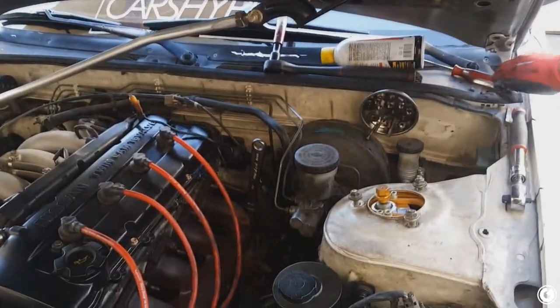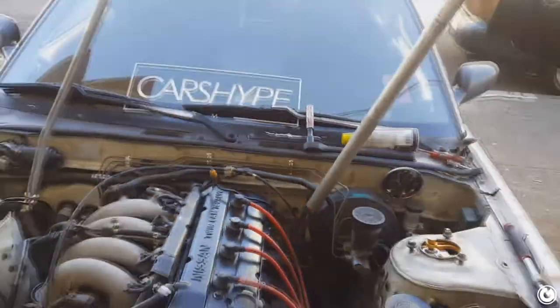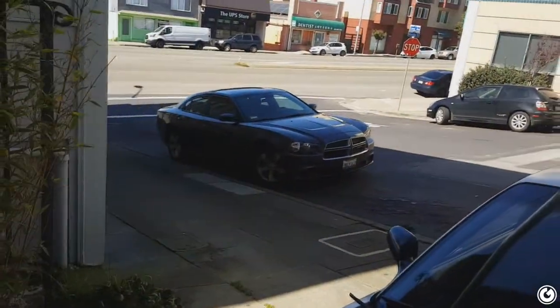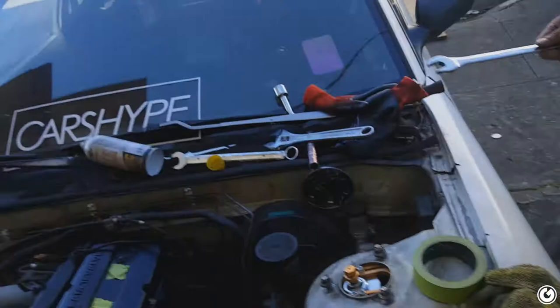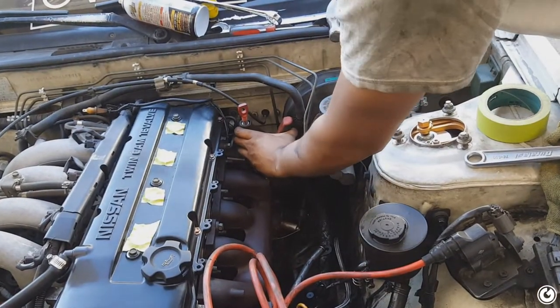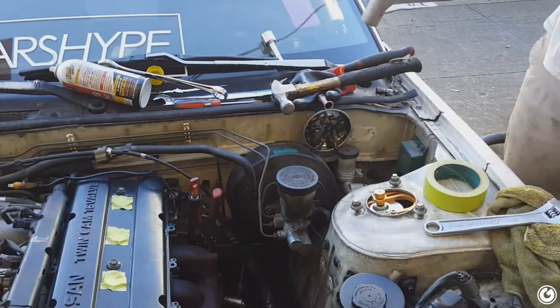We decided to take off the hood in order to fit a jack handle on top of the wrench so we can get a lever arm going and get more force applied instead of just struggling with that short little handle. It was a great idea but it's too big and too small. Went over to Napa real quick and picked up a 24mm wrench. A combination of the fulcrum arm, vice grips, and penetrating oil finally allowed us to break it loose.